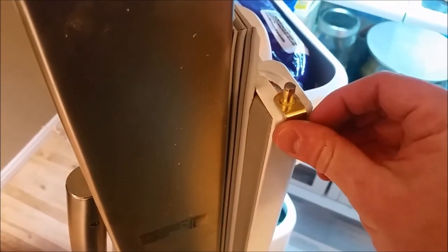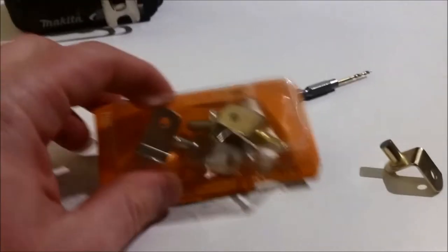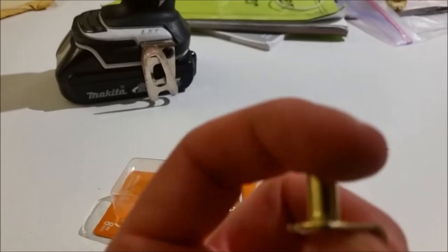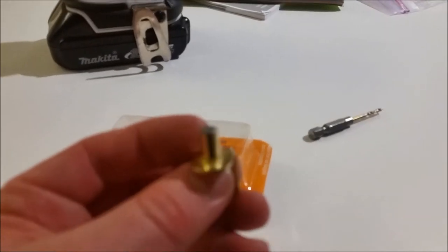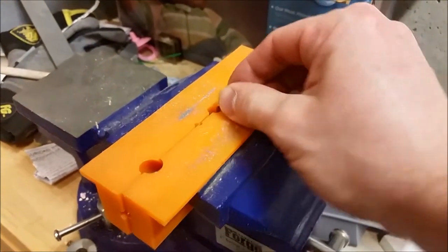This little piece will fit on top just like that and fit right in the right spot. I'm going to take one of these shelf brackets that you can buy at the hardware store to put shelves in, shave down the top of it a little bit, and use it to fix the mullion on the fridge. I'm going to mount it in the vise right here and then shave it down just a little bit.